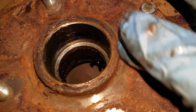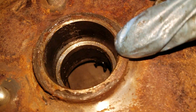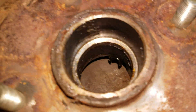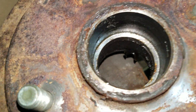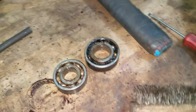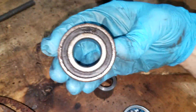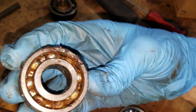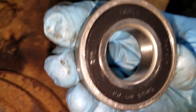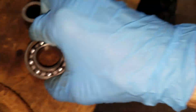This dust cap has been glued on with RTV by someone in the past because they stubbed a chisel into it and screwed it up, and I didn't buy another one. I think I'm just going to clean that up and put it back on with RTV. There's the old bearings — we can throw those away. If you look at the old ones, there's a seal on one side but not on the other, and that's the outside bearing — has no seals on it. The new bearings have a seal on one side but not on the other, and the inside bearing has a seal on one side, which is correct.